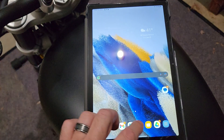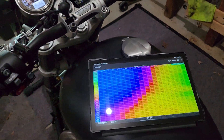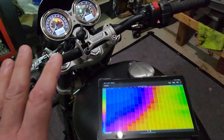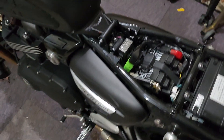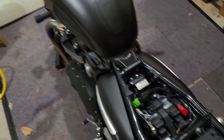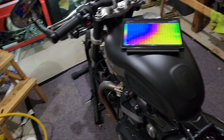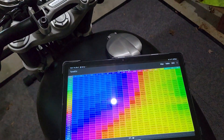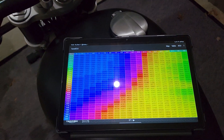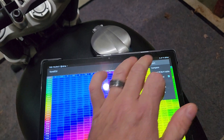So what we want to do is now go to our TuneECU app. Turn on the bike. Now, normally if you're going to flash an ECU, I would pull the headlight fuse and then put a battery tender on just to make sure your voltage doesn't drop in the middle of the flash because it takes like 18 minutes. We don't want it to disconnect and break your ECU. Just for doing something simple like this, it's fairly straightforward. I don't even know what map I've got open, but I'm not going to flash a map anyway.